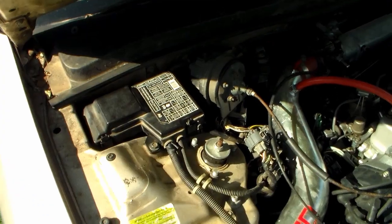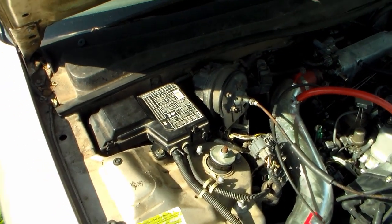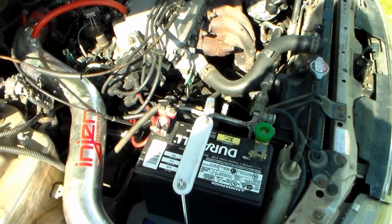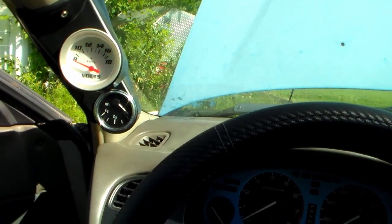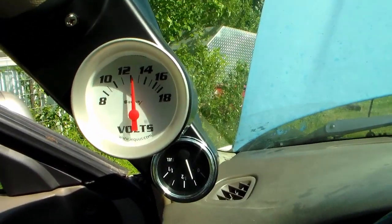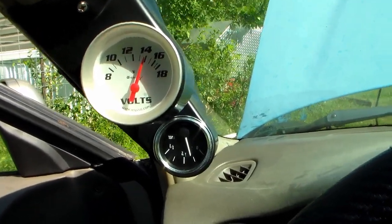So how do we know if that works? Well, the only way I can answer that is if you have a digital multimeter or a volt gauge installed aftermarket in these cars — because these stock do not come with a volt gauge, but I happen to have one installed. You could check the battery with a multimeter while it's running and see if it's charging and how much. It should be charging at 14 volts. I'll reconnect the battery and turn the car on. When it's on, it's just above 12 volts, and when it's running — if the alternator is always on — it's going to be at 14. And it's at 14.